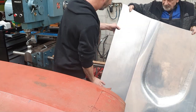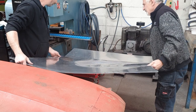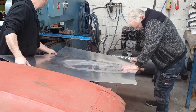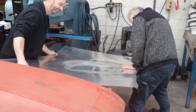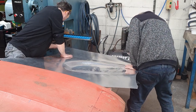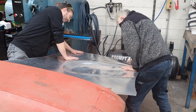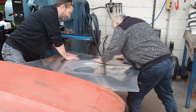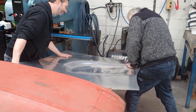We've carried the sheet over to another area of the workshop. We've got a piece of solid bar fed through the pole mount just to support it, and a piece of timber — I think it's a bit of hand banister or hand rail — taped to that solid bar. It's got a really nice elliptical profile which suits what we're doing quite well. We line up the body line we just folded and basically push down to form some of this reverse. It's a bit of a non-engineering solution but sometimes you've got to do what you do to make it happen, and we'll finesse things afterwards.